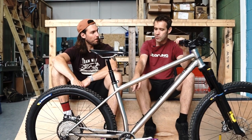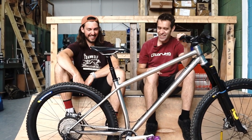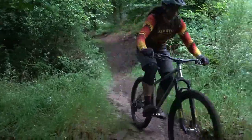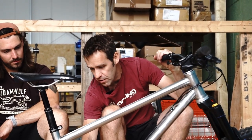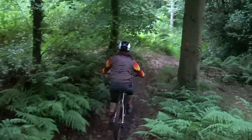We've got this yoke feature. When we first released it, it caused a bit of controversy. The logic behind it was that full suspension bikes have kind of got that design and it gives really good tyre clearance - it works really well. So all we've done is just move it forward 10mm. A lot of people will say it gives you really bad chain slap - it doesn't. If you think about it, having a shorter distance between the chain and the chain stay means the less it's going to slap because it's got less time to accelerate. Put a bit of 3M tape on it - no chain slap, nice and quiet. You get chain slap because your mech's knackered essentially.